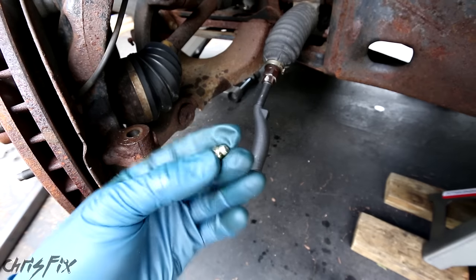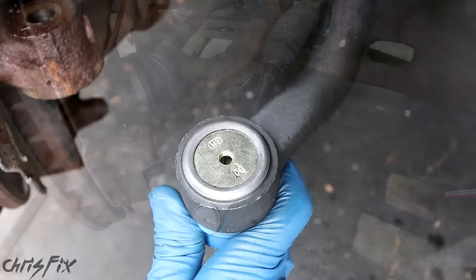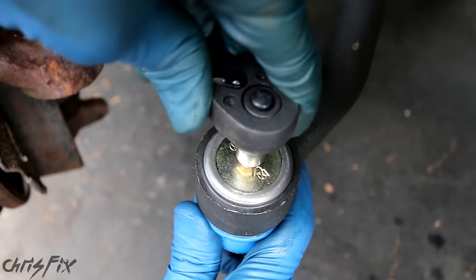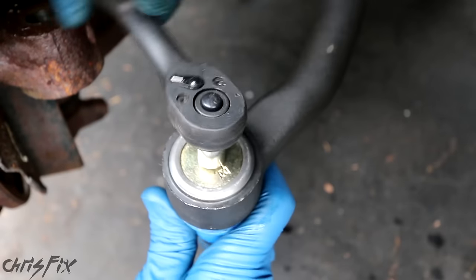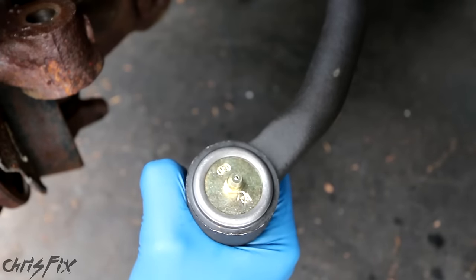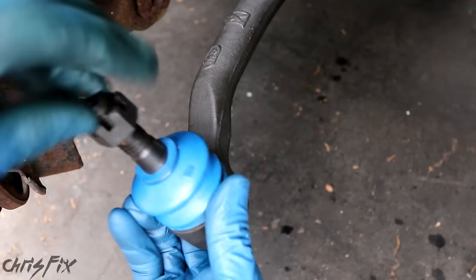Now's a good time to get the grease fitting and install it, because this is gonna be upside down and might just be a pain to install it upside down. The grease fitting just threads right into this — do it by hand to start, make sure you don't cross thread it. In this case it's an eight millimeter. You don't want to tighten this too much, just get it snug. Once it starts getting tight just snug it right down — just take a turn, that's all you want to do. You could over-tighten these and strip it out. We'll grease this at the end; for now let's go install this.